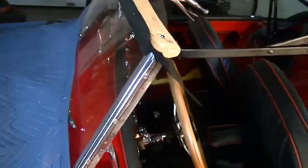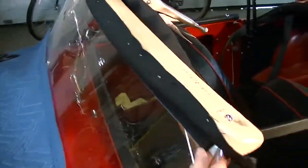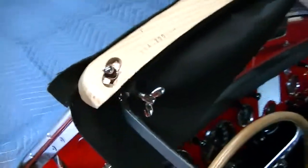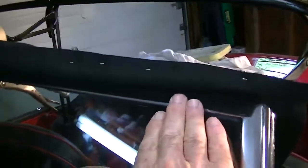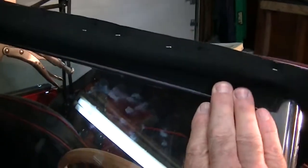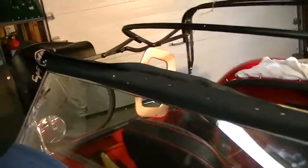The first step for putting the convertible top on is putting this sheet here, which wraps around the front wood and the frame as it's screwed. The frame continues around here in metal and is screwed up into here with all new screws. The main purpose of this first flap is there's a weather strip along the bottom edge here. It hangs down and its purpose is to go about the length of the chrome, but not encroach onto the glass, and it keeps rain from getting up and underneath.